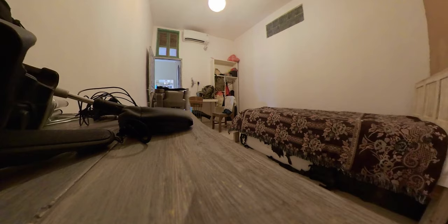The next day I let the device run off its battery for as long as I could — three or four stints of 30 minutes each, back to back with no time in between. I completely filled a 128 gig card with it and didn't get the slightest bit of condensation inside the lens. The moisture used to come in at about 10 minutes of constant recording, so with a couple of hours of recording down and no fog, I'm happy it's completely fixed.